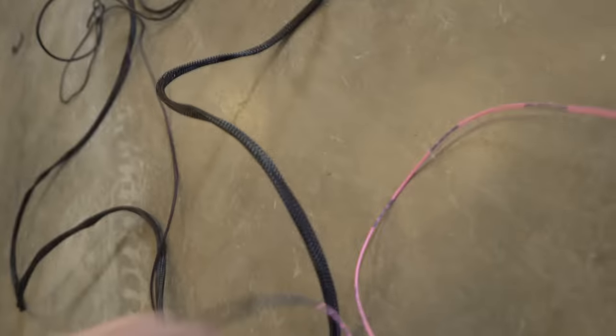Next step is wiring the air compressor. It has a red and black wire that connect to the matching red and black on the wiring harness. Use the included butt splice connectors — cut off the existing connectors on the compressor wires, strip the ends, and use the two butt connectors to join them to the harness. I'm bringing the compressor to the trunk now. It'll just be sitting loose for now until I build the custom trunk setup — it won't look pretty, but it's temporary.